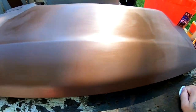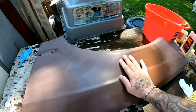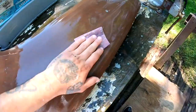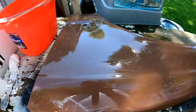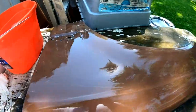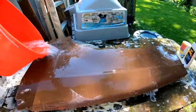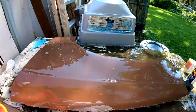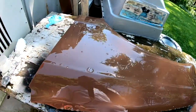So what I'm going to do is wet sand the whole thing down with 320 grit and respray. I just hit the whole thing with some 320 and soapy water. Now I'm going to rinse this whole fender down with some clean water and we'll continue from there.